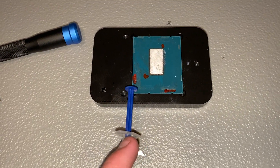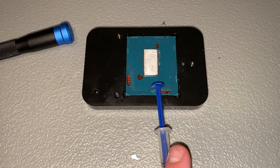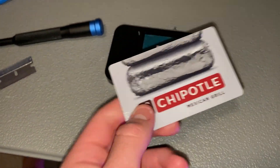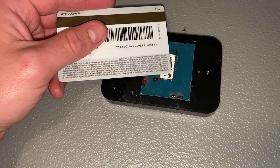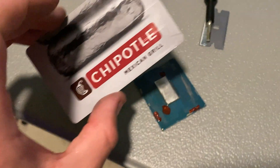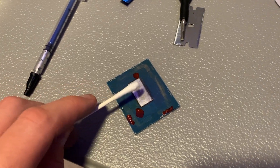Make sure you put something over these two caps especially — I'd also recommend covering the surrounding ones if you're doing this, just so none of the QuickSilver or liquid metal gets on them. I put some on by unscrewing the cap and just tapping it. Then use whatever gift card you have — unused Chipotle gift card, please sponsor me — and just rub it all over the die. You want to have no solder left. Then swipe it off going this way or that way, keeping those caps covered, and use Q-tips to get the rest off.